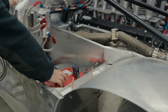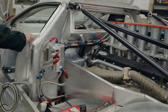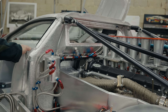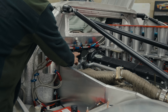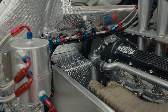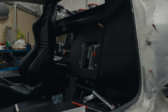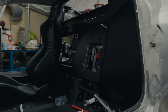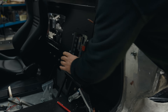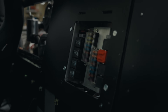The next big job was mounting the batteries and running all the battery cables together, running the earths, and from there we can start to finalize the electrics. The fuse box and everything's in there, accessed from behind the front seat in the cockpit area, so all your fuses and relays are in there. Then eventually we'll have an ECU unit which drops into this area here, with a cover panel over it but with an access hatch, so all of the main electrics are centralized behind the passenger seat.